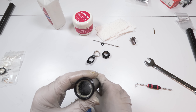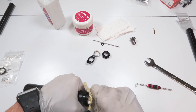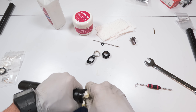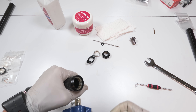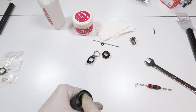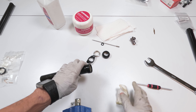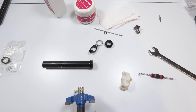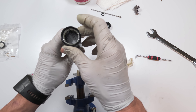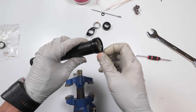You don't want any kind of debris or contamination in there. But the big one is the bearings — it's a pain but it's worth your time since you're going through this anyway. Take a few extra minutes and just squeeze and pull out, squeeze and pull out. I highly recommend not putting brake cleaner in here — that would work like a charm, but this is plastic and brake cleaner and plastic don't do well together. Let me go and clean this out best I can.